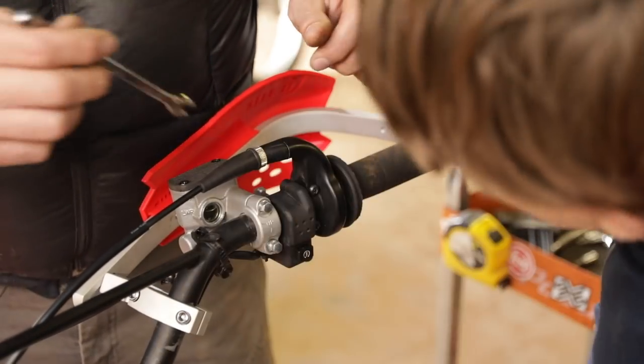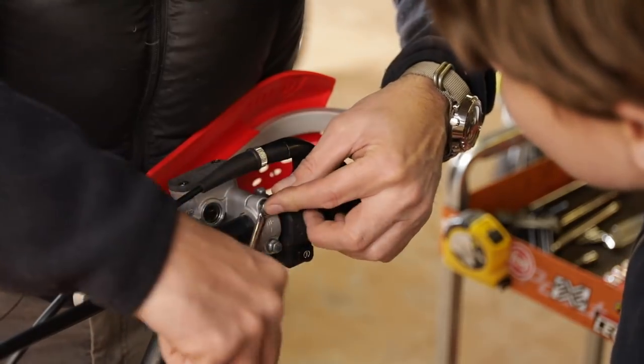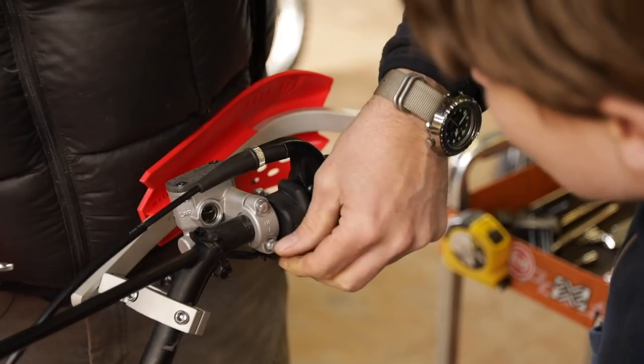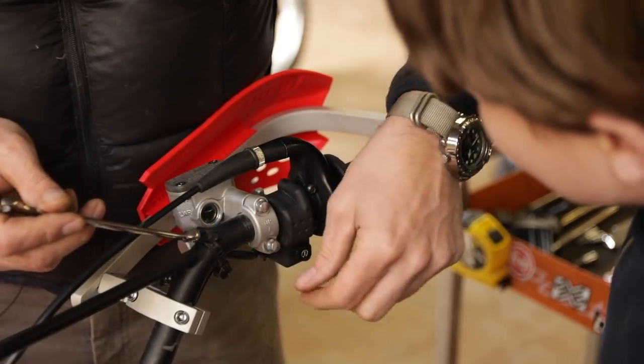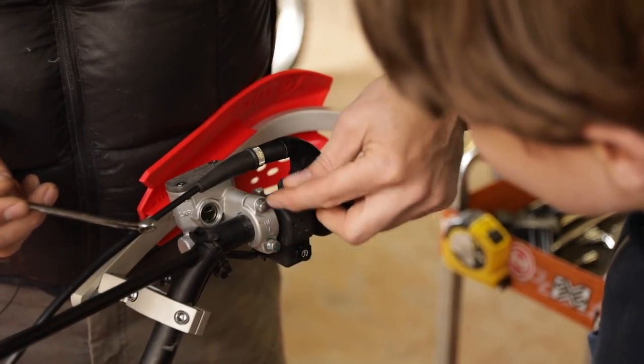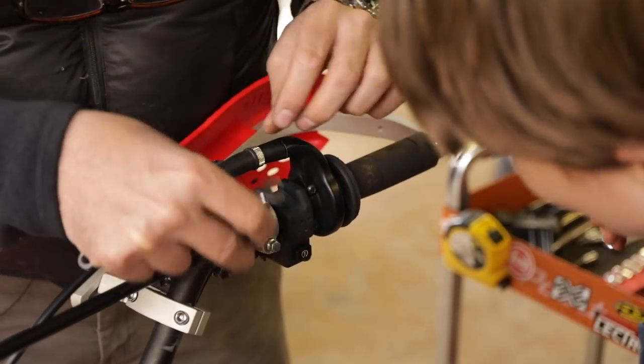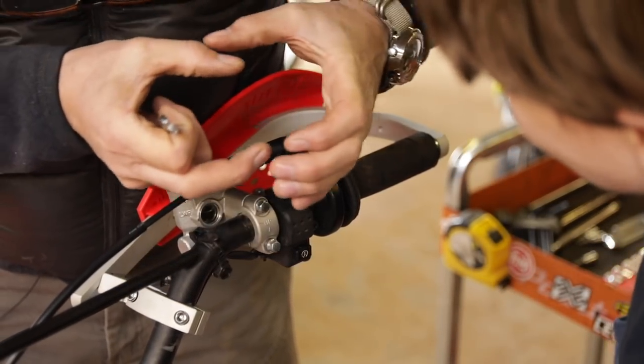It's quite large. Right. So when everything's said and done, what you want to do is tighten those equally. Get a ratchet instead of a wrench, and say do four turns, four turns, four turns, four turns, and then when you're tightening, tighten it up so that those gaps are the same on both ends. That way the clamping pressure is equal.